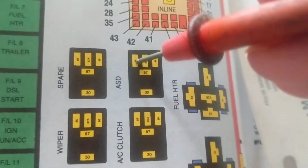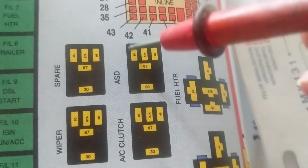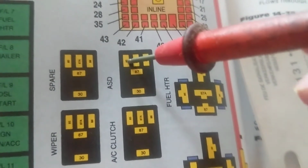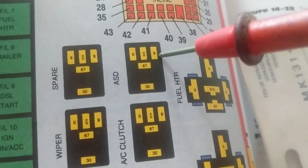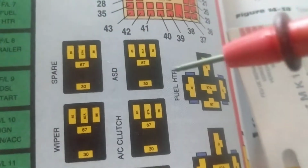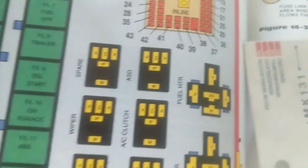Why? It shows me that current is being drawn through the relay and through the circuit that it is connected to. It could be a headlamp, could be anything. I know the fact that it dropped from 12 volts to 11.37 volts or 11.7, 11.5, whatever, shows me current is being drawn on this side of the relay. Most important. That's why you have to have a relay inserted inside and do these measurements in circuit. There is no sense in the world to take a relay out, measure and say the load side is 12 volts, this is 12 volts. Makes no sense in the world whatsoever.